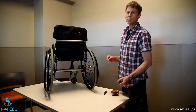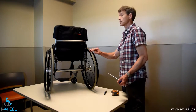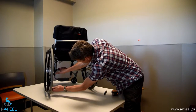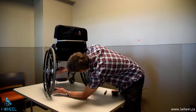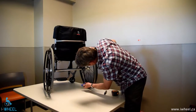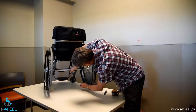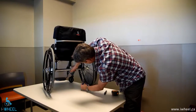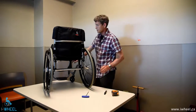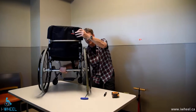There are different ways to adjust toeing error. I'm going to show you first on a chair with an axle bar, because this is the easiest to visualise what actually happens. You have to find what it is that clamps the axle bar to the frame — this is as simple as it could be. Make sure the allen key is all the way in and loosen it off. So I've loosened off the axle bar. Now if I rotate that axle bar, you can see how the orientation of the wheels change.